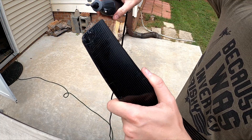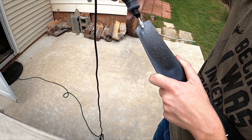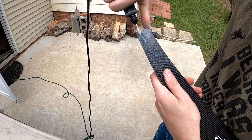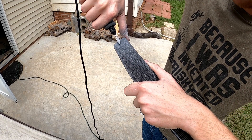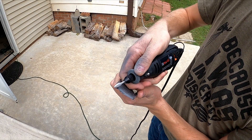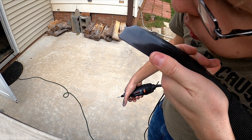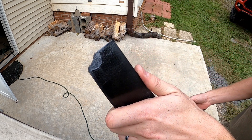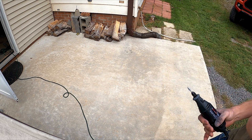I've got a Dremel here with a small acorn grinder and I am grinding away all of the damaged bits. I scribed in there with a pick the area that was damaged. My goal is to get all of the damaged fibers gone so that it looks something like this when I'm done — at least one layer down and trying to straighten out the damaged area.